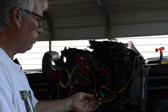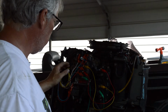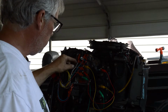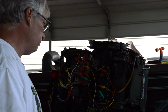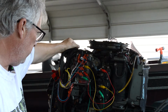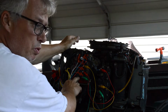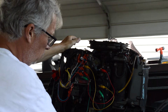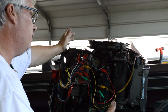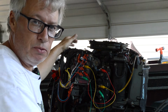at some wiring diagrams. I have some little jumpers here just because usually on Mercury, your violet is your number one. And then from there, this engine fires 1, 3, 2. But on some of these, the number one was the brown. So I've got it right now, number one is the brown. And, I mean, it's still firing off different. It's not firing where it's supposed to be.